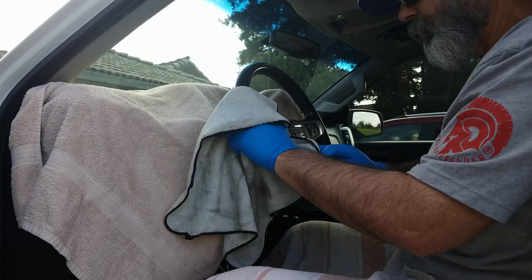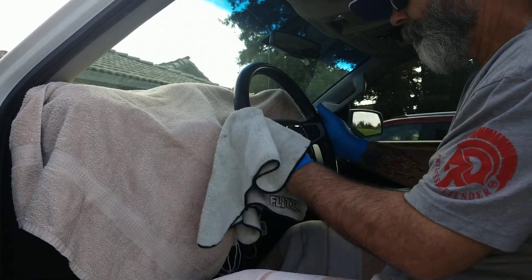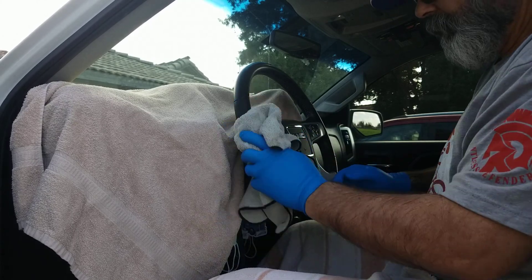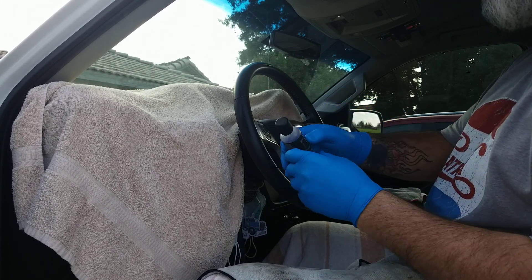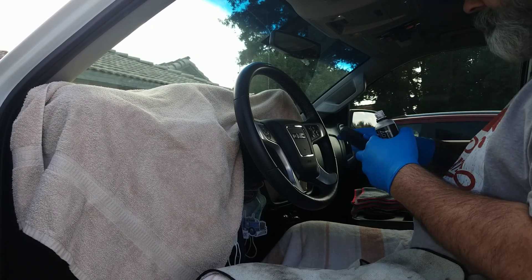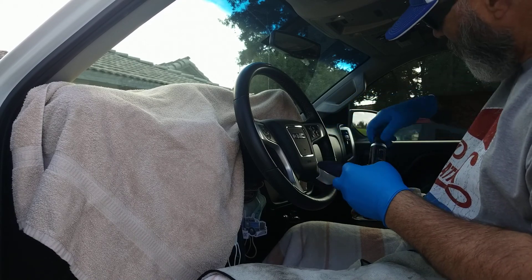This steering wheel is pretty clean, so we're doing this at the right time — there's no real degradation of the cover. It's been in the sun for four years without protection, so perfect timing. That's the cleaning part. Let it sit a minute. I'm going to break out Adam's Ceramic Interior Coating — it's for leather and vinyl, so it works on this. It kind of smells like mothballs. Put some on your applicator of choice, apply it all around, let it dwell a minute or so, and buff it off.